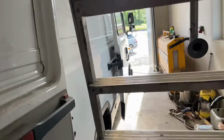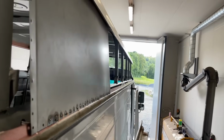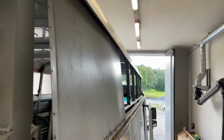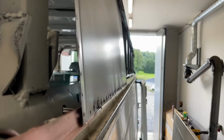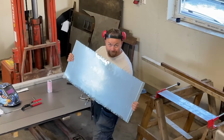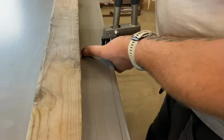Since we put the first plate on, it's been like 2 hours now. And I think you can see why it's been like 2 hours. We could not get our heads around why the steel plates kept on bubbling up on us, until we realized that with these kind of thin steel plates, when you put welding on them, the heat from the welder starts to change the material and makes everything wobbly.